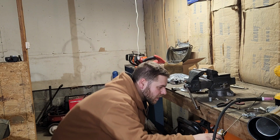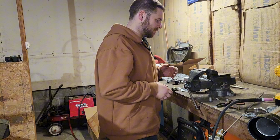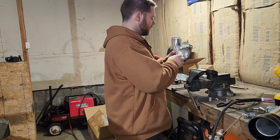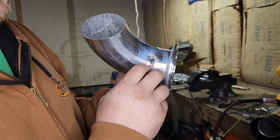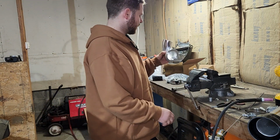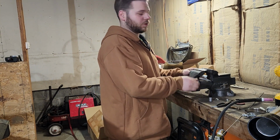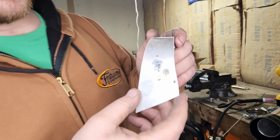I have figured out I am very low on gas. Still getting some out of the tank, but sometimes the bottom of the tank, it's not as good. But this is what I was running into. So you can see just nasty porosity, like the gas isn't doing its job. I'm having plenty of gas flow, but my tank says it only has 100 pounds left in it. So I thought it was the cheap Chinese aluminum, but I went and got a good piece of aluminum that I've welded on before. This turns out good. And it's doing the same thing.